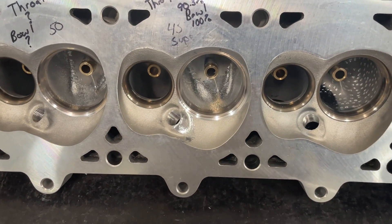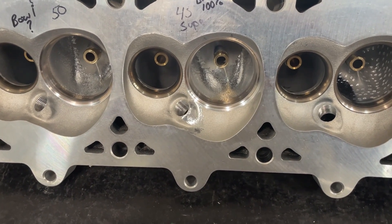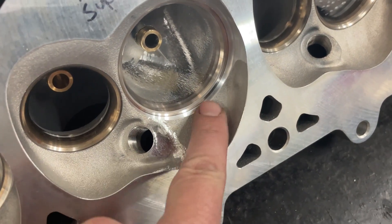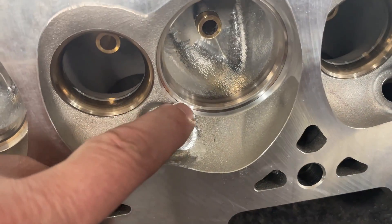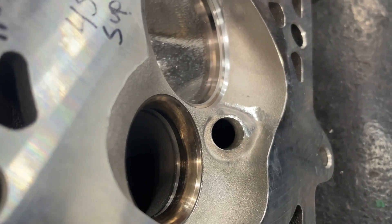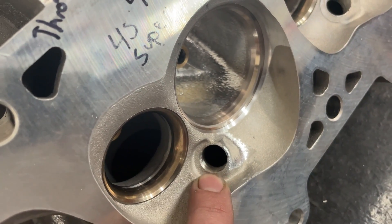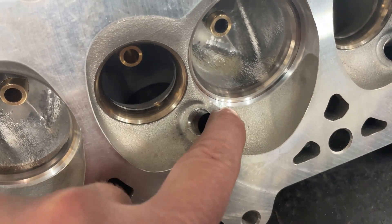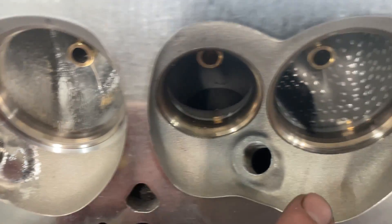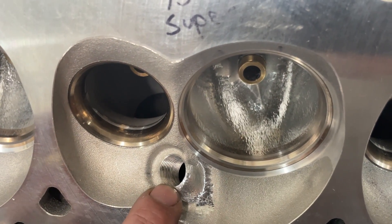As a bonus, one of the most mentioned comments is how come I didn't rework the spark plug. So this is how it is from the factory. I haven't smoothed it up because I haven't worked the rest of the chamber yet - I'm going to do that separately. All I addressed right here was just going around the spark plug itself, getting it more contoured. I could have knocked the whole thing out but that would leave threads exposed to the spark plug. Honestly if someone were to port it, it would probably look something similar to this but polished. The chamber's not done - all I'm simply measuring is if taking out this huge chunk here and rounding it will have any difference on flow numbers.